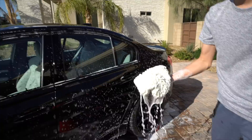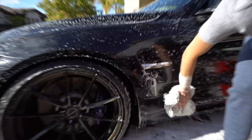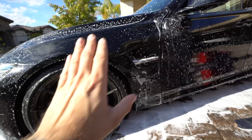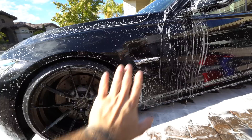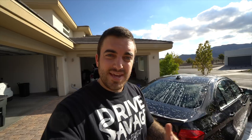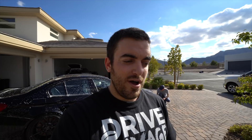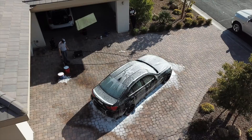You always want to make sure you're following the direction of the wind — as we're driving, the wind goes this way, so keep a consistent stroke along the vehicle and not rubbing it wax-on-wax-off style. If you're going to introduce any swirls to your paint, this is the main place you'll do it, so be super careful. If you need to spend a couple extra dollars on a better wash mitt, do it. We use one from Jay Leno's Garage, but The Rag Company has really nice ones too. Stay away from the noodle ones from AutoZone, as they trap debris that the grit guard doesn't always remove.